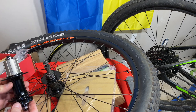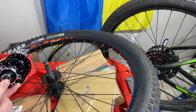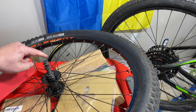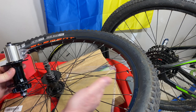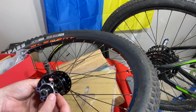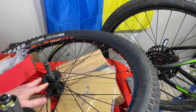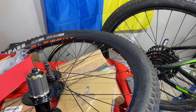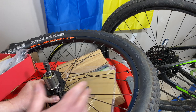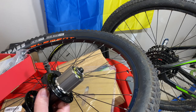You can see the rest of the hub there — quick release as well. Most freewheel setups have an axle, and there's a reason they don't go super wide range with a freewheel. But if you buy a hub, you can have it laced onto the wheels: take these spokes off, take the hub out, relace the spokes into the new hub, tighten it, true it, and it's all good. Except that's not easy — I'm going to be honest.